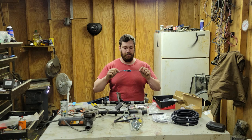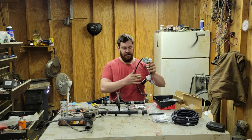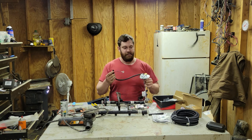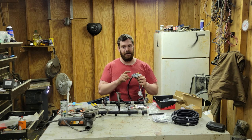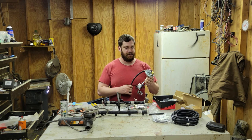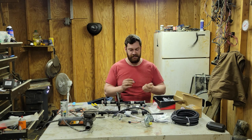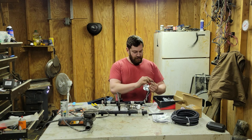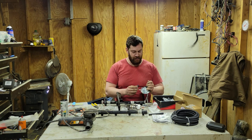I have a plug off of this harness that I'm going to use for my fuel pump plug because obviously I don't have that plug anywhere, so I'm going to get my nice fresh brand new sending unit and start cutting on it. I got some compression fittings for these, which you absolutely have to have. I don't think you're going to hold 100 pounds with hose clamps and a single barb. And lastly, I got compression fittings that are also 6AN, not for this side, obviously, it's for up here. You don't have to run AN fittings up here, but it's sure cool if you do, because apparently it makes it super easy.